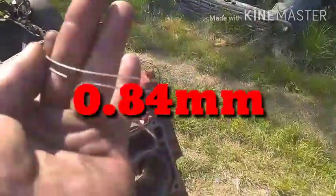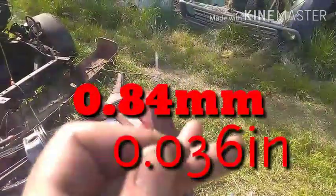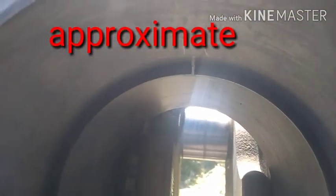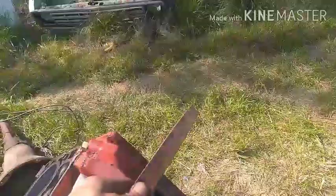Took my calipers and measured out what I wanted. This is an oil ring - oil ring doubled up - thickness right at the thickness I want, and I'm measuring them out. There she is. Pull them out, use a flat file, put them right here on the edge, file them, put them in, test it, pull them out, file them until I get them where I want them.